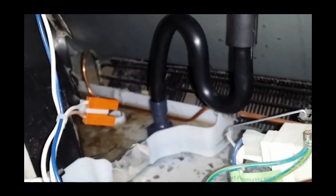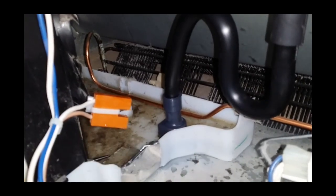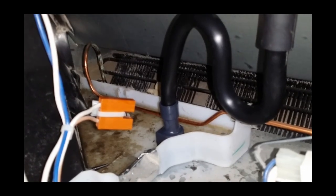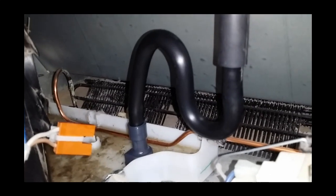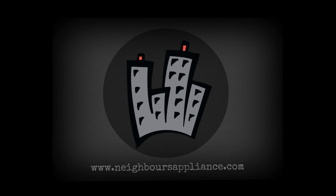That's it — that's installed. The main issue to watch out for: if you reef too hard on this down here you'll end up breaking the pan, and it's hard brittle plastic so it breaks really easily. Anyway, then reassemble. Until the bottom loop gets filled with junk — which will be the next issue — you've got a clear drain path with a loop in it so air can't get into the unit. A clear drain for your freezer section. Have a great day, guys.